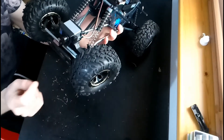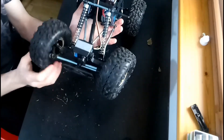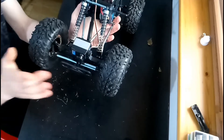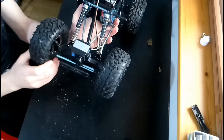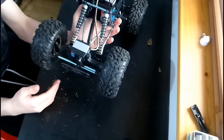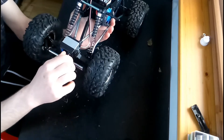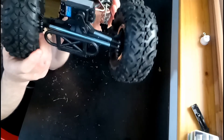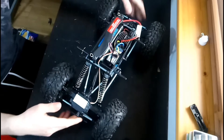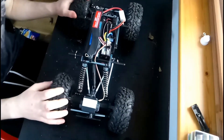This is a Maverick MS25 servo — it's all metal gears in here, and that's what you want. If you have plastic gears and you're off at an angle, your servo gears will just strip out straight away and you'll be going through a hundred of them. Metal gear servos are the ones you want, especially high-torque ones. You can see here as well the way the servo works is very complicated compared to on-road or off-road RC cars, which just makes this whole thing expensive for a rock crawler.